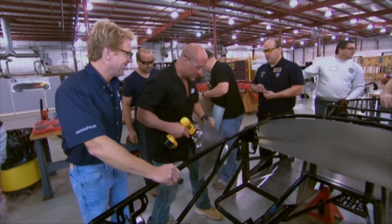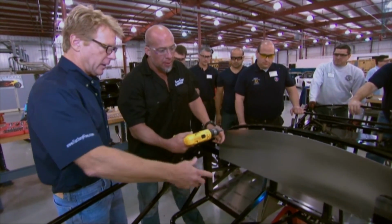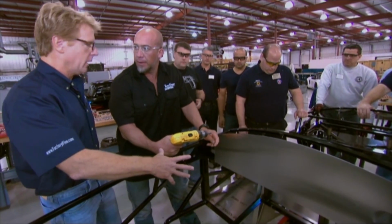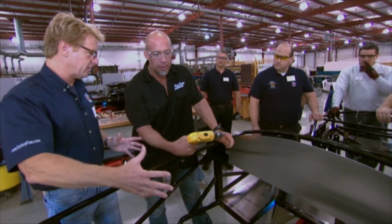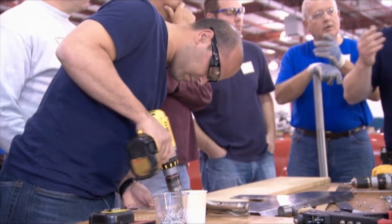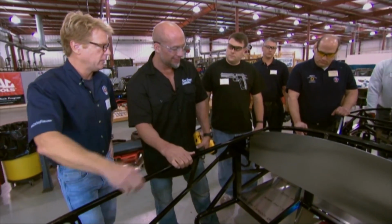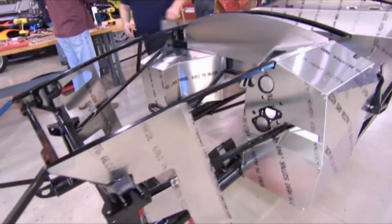All right. Hey, Willie. This is Dave. Hey, right on, man. Mr. Factory 5 himself. Right on. Thank you. Dude, I'm loving this, man. Well, you know what's cool is what you're seeing is the disassembly process. So what we're doing is Freddie in chassis assembly, he's taking these panels and he's using tech screws to position them. So when the guy gets this at home, he's going to take this out, but he knows where the parts go. Most guys are going to bond and rivet it and drill it out, and then when it's installed, you can sound insulate it, heat insulate it, or just run it natural. That's the way I do. Awesome.